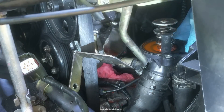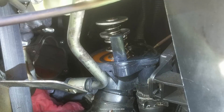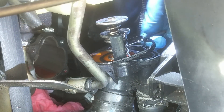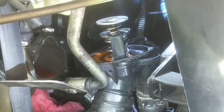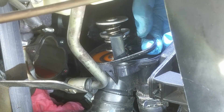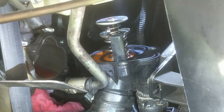Now this would be a good time to check the stat itself, and make sure it doesn't have any broken arms like they commonly do. That's a common mode of failure with these things. And if it was leaking, you can also check that the body is not cracked. But in my case, I'm just removing the old gasket, which is actually quite hard and sort of stuck in there, but I could get it out with a small jeweller's screwdriver.